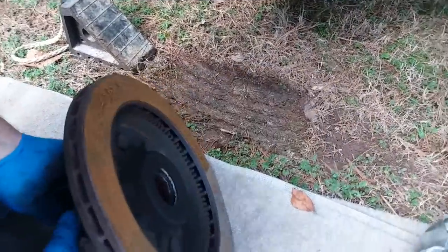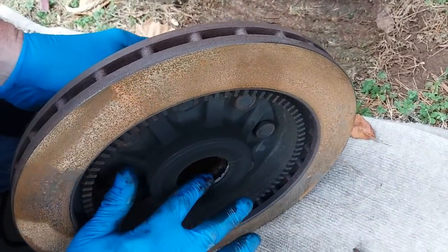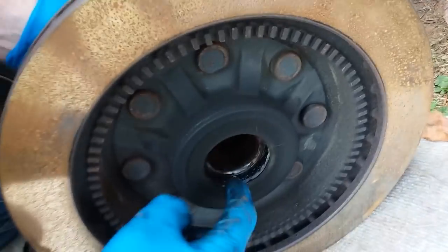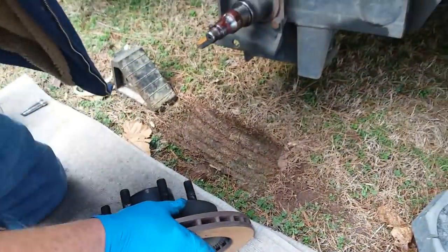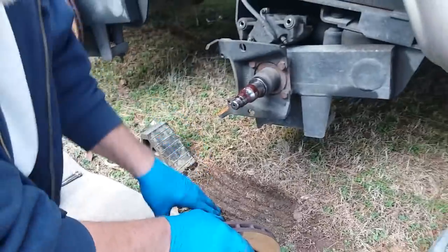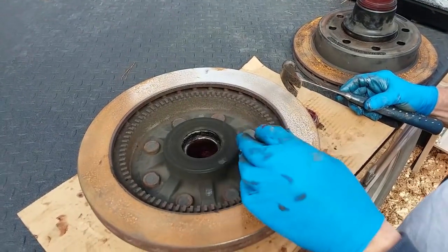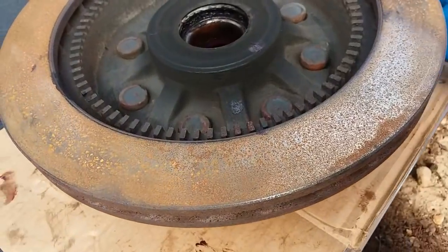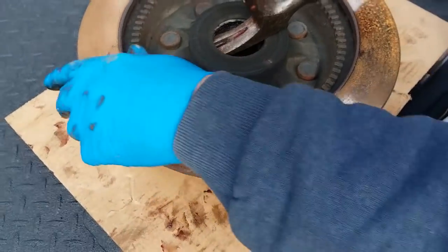All right. And then you got the rear bearing, and this is that seal that I was talking about right here. Oh, that you push back? That's a bearing in there, but this seal's on the outside right here. It keeps all the grease from flying out the back of it. Oh, okay. In order to get this bearing out of here, I have to remove the seal. And the seal's a one-time deal. You can only use it once. Once you remove it, it's no good. Hang on a second.